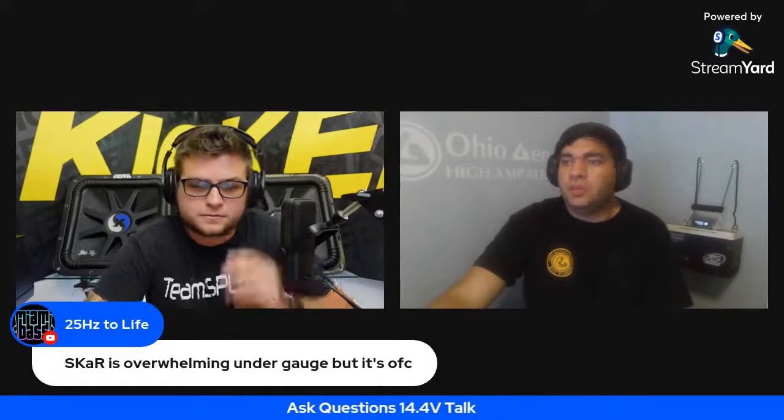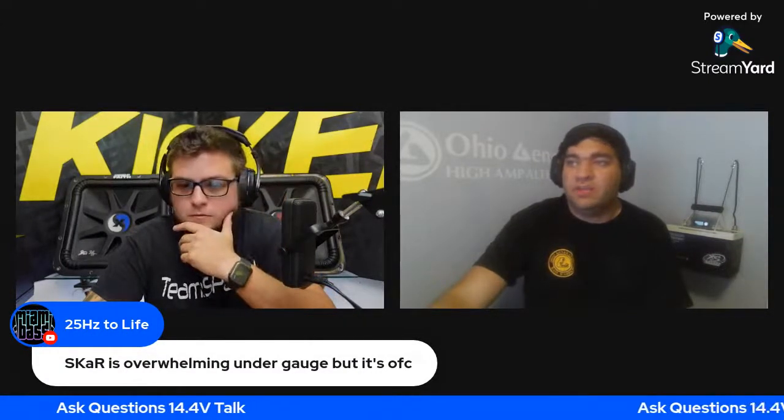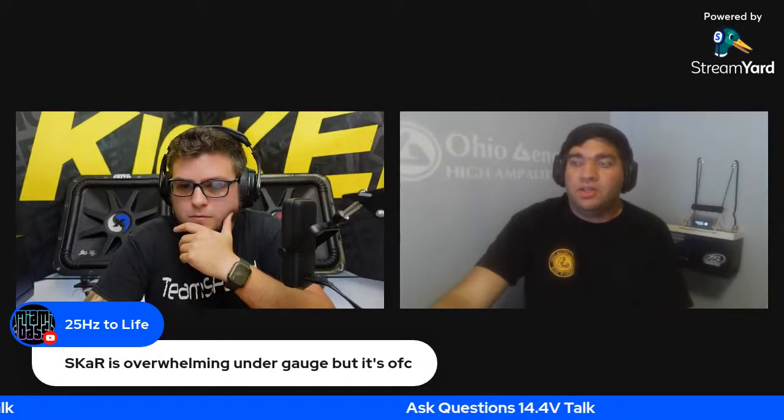So the guy, I can't remember his name now, Ray Gibson, he said he had a 99 Grand Marquis. Does that have the 220 amp alternator from the factory? I'm looking on Rock Auto here at your different alternators. Was your alternator a 130 or a 135 amp from the factory? They're both different, because the 135 amp is a 4G alternator, and the other one is a 6G alternator. So there's two different ones. He said 135, factory.